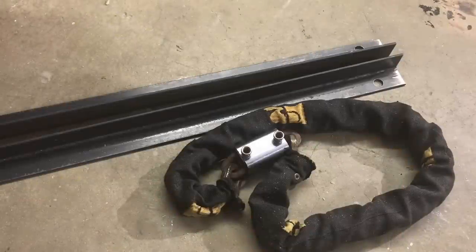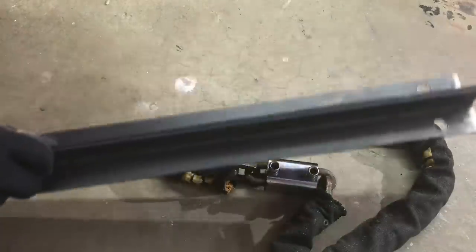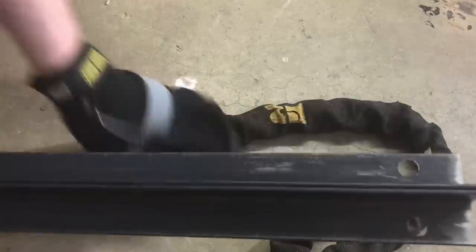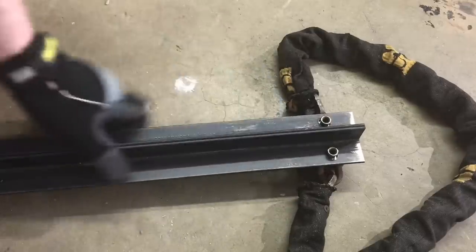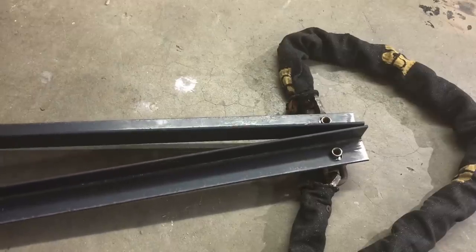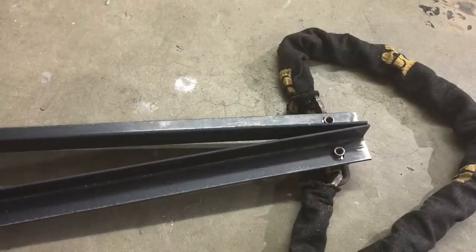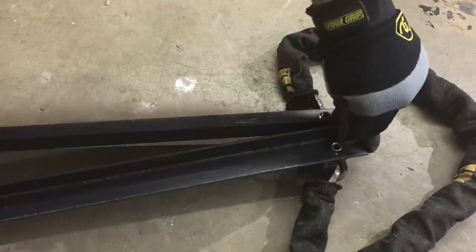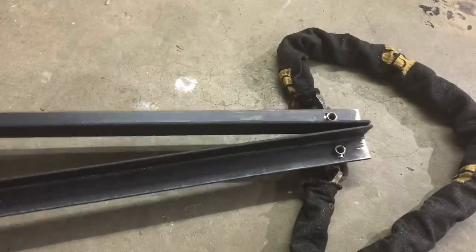Okay, folks, we're down in the garage, and our first attempt will be spreading these two shackles using these pieces of 1.25 inch angle iron. I drilled a couple holes in the angle iron so I could get this firmly over the shackles. And the idea would be to spread these apart like a class 2 lever and try to pull those out. So, you get these in the best possible position and start spreading.